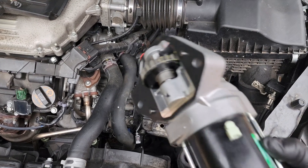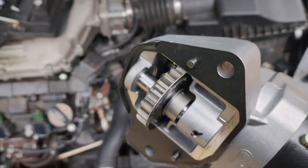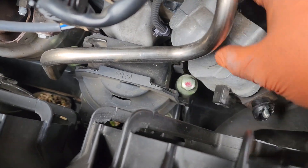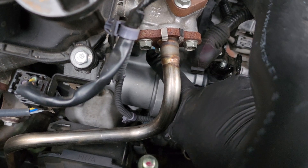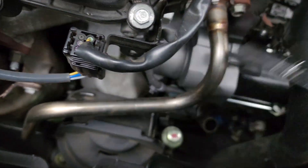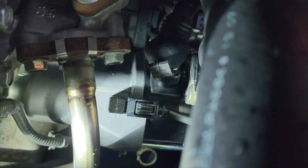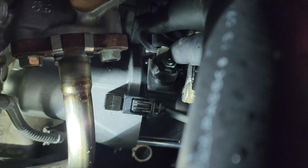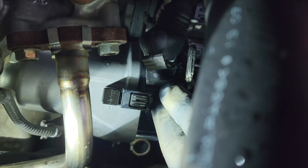It's not too bad, one-handed. Alright, we've got our remanufactured starter from Honda, so we'll just go back in the same way we took it out. Put your two 14mm bolts back in and tighten them down. With our two 14mm tight, we can go ahead and put our B-plus cable back on with our 12mm nut and tighten that down. We'll go ahead and reconnect our S-terminal connector.